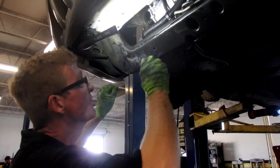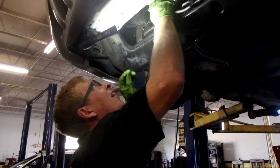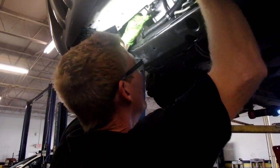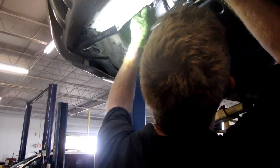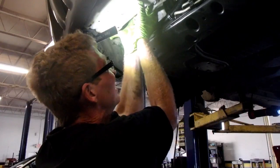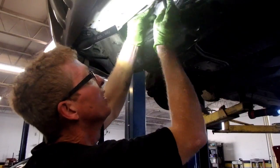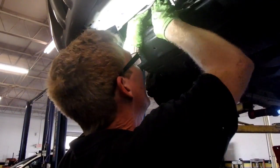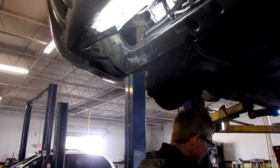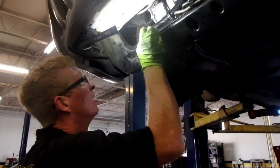Let's get that other suction side line on here. I hope. It's a stud that sticks out pretty far on that thing. I'm going to bend this line down just a little bit, enough to line it up. Snap that back in place before I put this thing back together. There we are. They're started. Two 13mm nuts to hold those lines on.